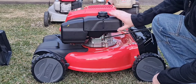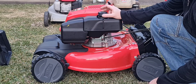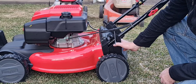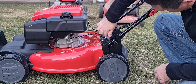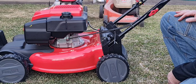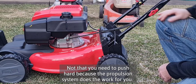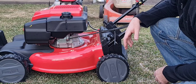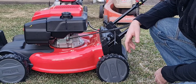The fuel tank is under this gigantic plastic cover — 1.2 litres of fuel — and they recommend no more than 10% ethanol. Now here I think is probably a pretty substantial weak spot: the mount for the bars is all plastic. There's a little screw and nut through this plastic bit holding it in place, but when you're pushing it there's a fair bit of flex from the top of the bars down to this point. It might break, or it might absorb a lot of impact and be easier on the hands. Time will tell.